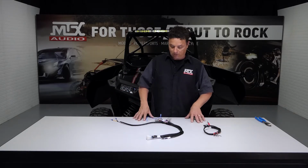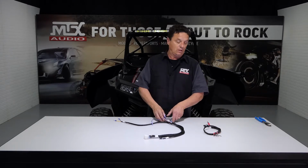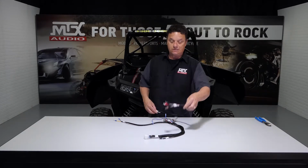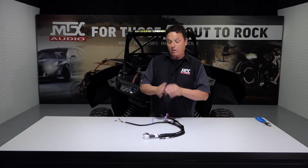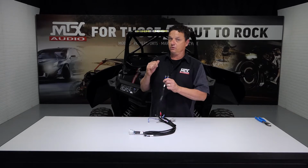All right, now it's time to install our head unit wiring harness. Now, in this particular kit, we're not going to be using the speaker outputs from the radio, because we have 2 dedicated amplifiers. So we are going to install the radio input harness. To make this easier, we suggest you run it when you run the head unit plug. Simply tie it together and run it down to the location where the radio is going to be, and leaving everything else to come back up to the center of the dash, because the whole point of this is getting these 2 power and grounds out underneath the hood. So let's go ahead and get that ready to go in the car.